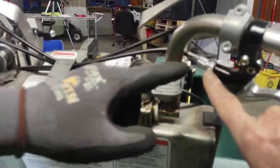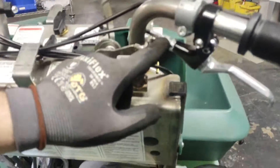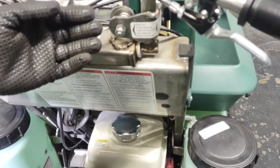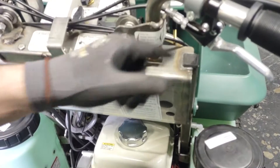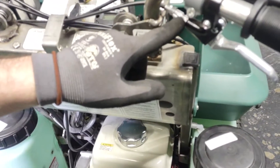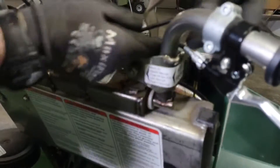Whether you're at 3200 or even 3340, this adjustment will raise your RPM. The farther it's adjusted out, the higher it goes — however it only does it by small increments. You'll notice in time that the cable will wear and you'll have to continue to adjust it. Since this one's already adjusted out pretty far, I'm going to start by running that nut in, and then I can take that whole assembly.